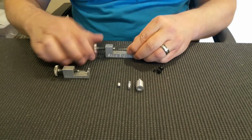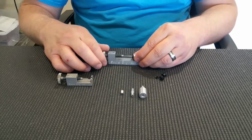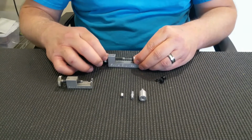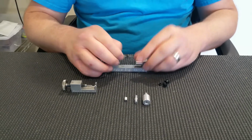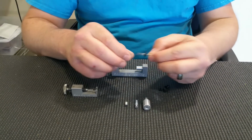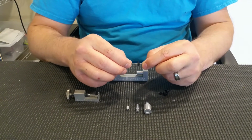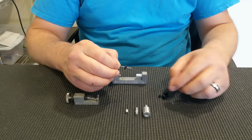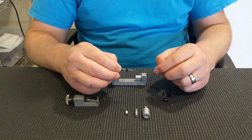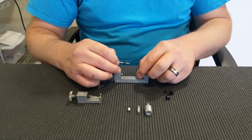So since there's no burr, we'll go ahead and move it the rest of the way forward. I have my stop set already for this setup, and that's step one. So now we have our axle on our gear. You can go ahead and fit this in the car and make sure that it fits properly. You want the same amount of axle sticking out both sides.